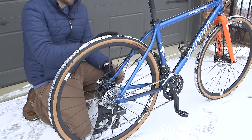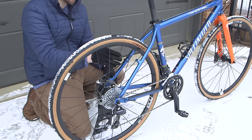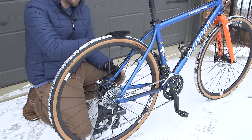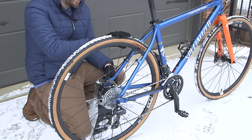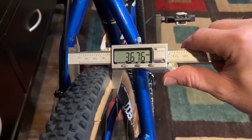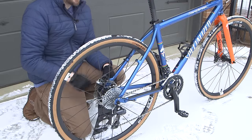The big change I made after putting this together was changing the wheels and tires. I got a good deal on a DT Swiss tubeless wheel set and found a used set of WTB tires, which allows me to run tubeless with wider tires. These are 35s but they measure out at 37 millimeters, and to fit them I did have to cut out the seat-stay bridge.